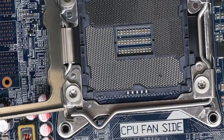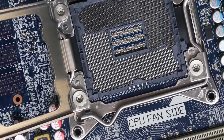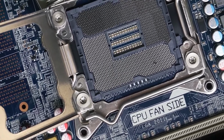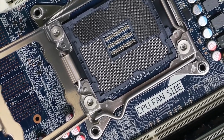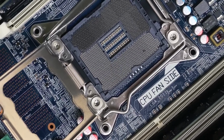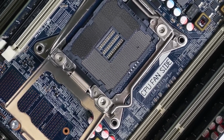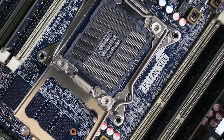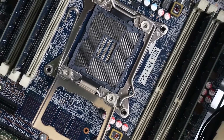We mentioned earlier there are 2 versions of this workstation. The main difference between the two is the CPUs they support. The Z420 version 1 can support E5 1600 and E5 2600 V1 processors, while the second version can support E5 1600 and E5 2600 V2 processors. Please note that when using an E5 2687W processor, it will require the optional water-cooled heatsink.